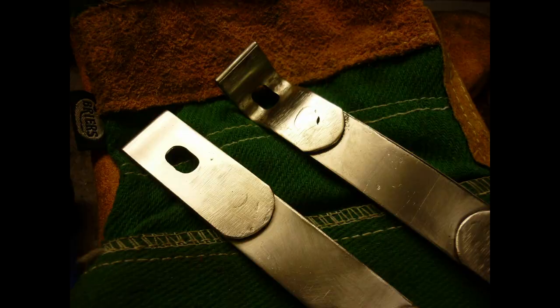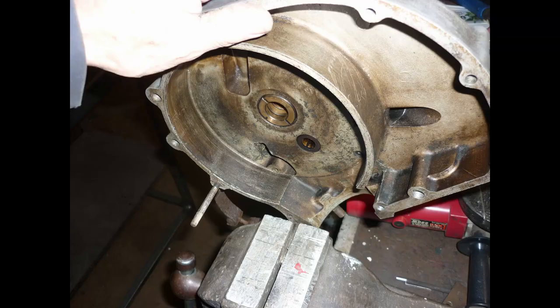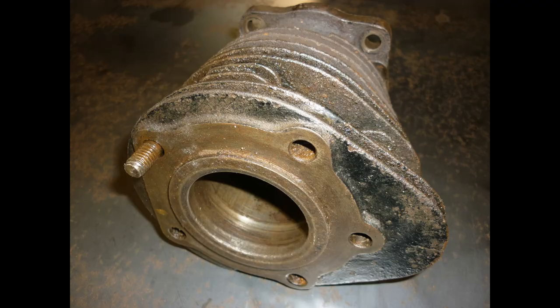Aside from that gearbox, parts are generally undamaged by an agricultural toolkit, as seen in the condition of rocker nuts and spring washers. Seized crankcase studs are nipped in vice soft jaws to aid removal. The engine, still on standard bore, appears to be a year earlier than the bike. The spark plug was missing.